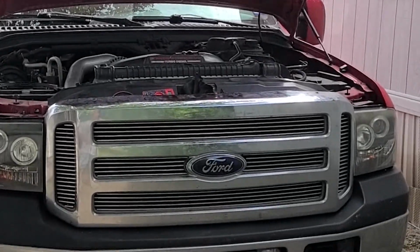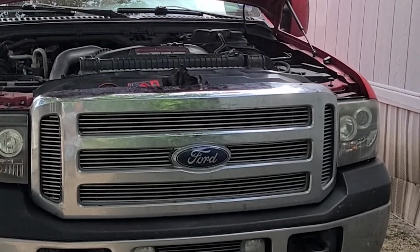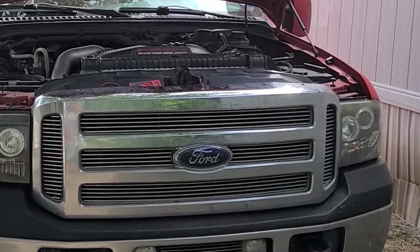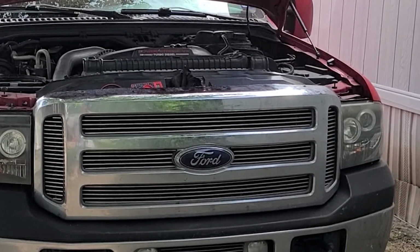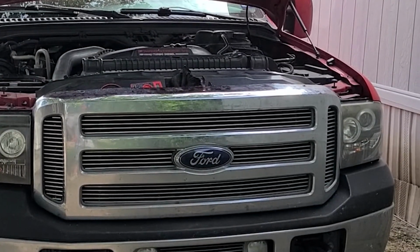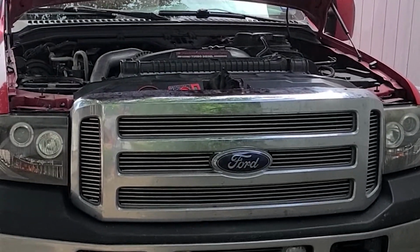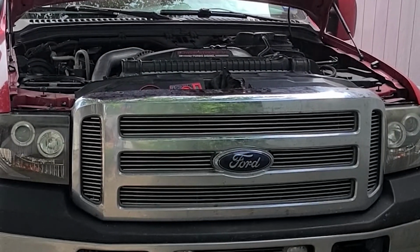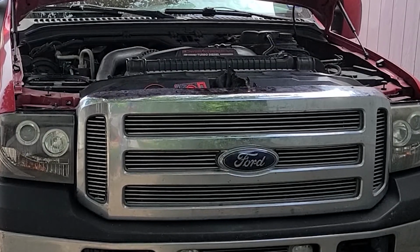The other day, I replaced the right front turn signal, only to be on my way to work the next day and have it fail again with the hyper flash going. And the right turn indicator stayed on solid on the dash. So when I got to work, I checked and I had neither a right front marker light nor a turn signal. So apparently we've got a wiring issue, maybe a corroded connection somewhere, I don't know. So we're going to have to do some exploratory surgery.